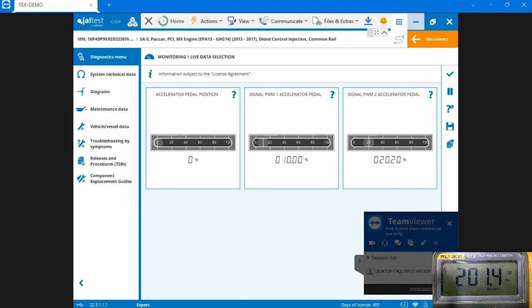You don't really know what voltage you're getting on the software - you have to look at your percentages. To show this, I'm going to press on the accelerator pedal so everyone can see what the signals look like fully pressed. With the pedal pushed all the way down, signal two is almost at 90% and signal one is at about 44-45%. The computer looks at the difference between the two signals, and if it's off by a certain percentage, it will log a fault code for your pedal.